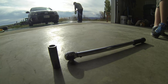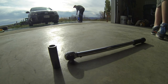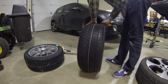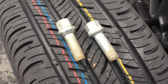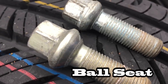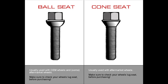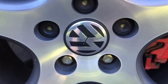What you will need to provide yourself is a torque wrench and a 17 millimeter socket, preferably extended to avoid coming in contact with the wheels or vehicle. I also like to have some work gloves. What is important to note about aftermarket wheels is you will need to ensure you have the right lug bolt length and seat pattern. The stock GTI wheels, as do most Volkswagens, have a ball seat lug, and our specific aftermarket wheels are cone seat. If you are changing a flat tire to a spare, use the ball seat lugs already on the vehicle.